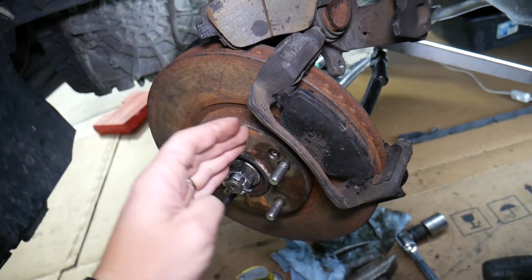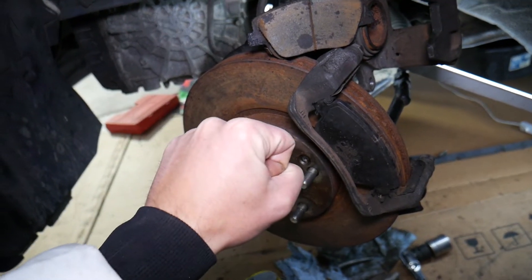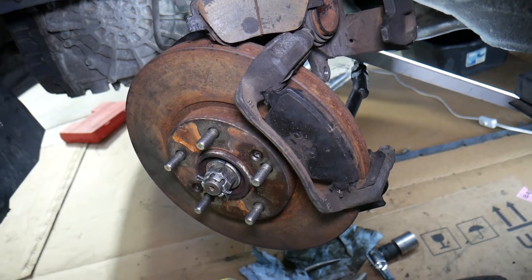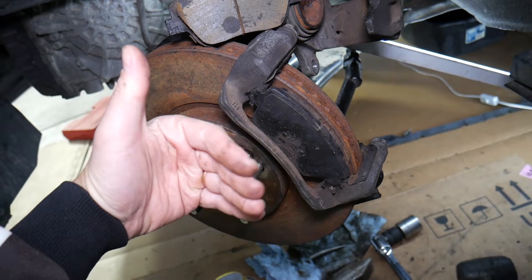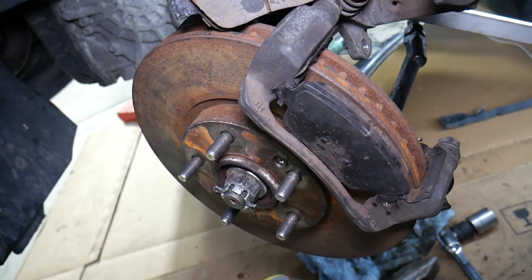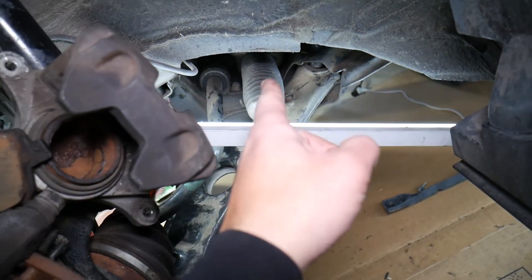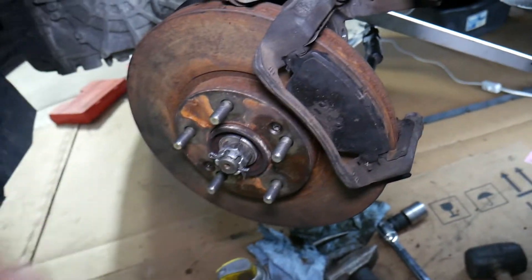The front right side will be exactly the same. When your steering wheel starts vibrating when you hit the brake pedal at higher speed, that's known as brake pulsation. What causes brake pulsation? Usually it's caused by the front wheels, because the front wheels turn. When you apply the brakes, the brakes start vibrating and transfer that to the tie rod, from there it goes to the rack and pinion, then the steering wheel — and you feel it inside and the whole car shakes.